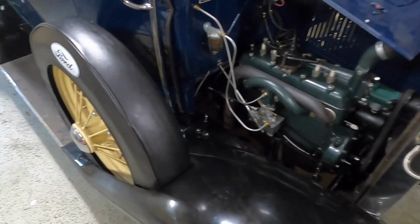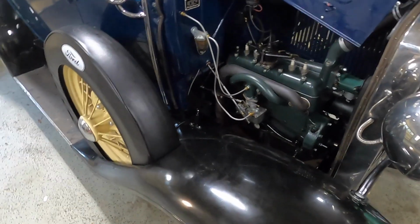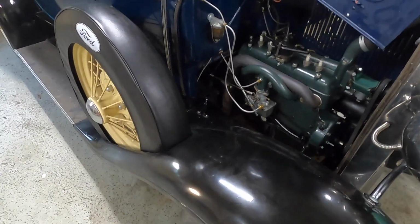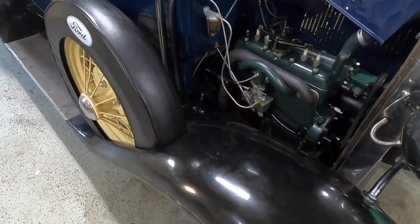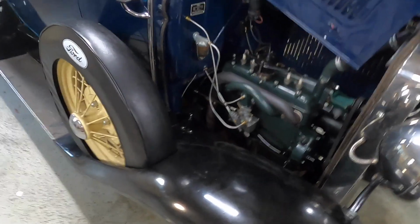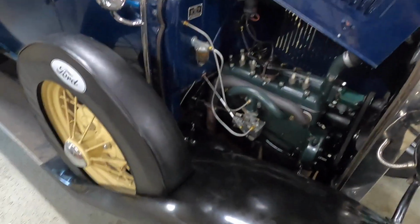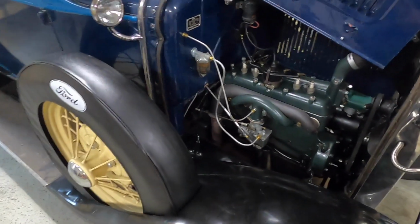And it has handled it all phenomenally. I have not had any kind of issues. The vibrations that I had previously with my old block, where the center babbitt had gone out more or less, they're all gone. Even when that engine was at its best, this one with the counterweighted crank in it is just smooth. It's still a Model A. You still get the same sound from it. You still have the same performance. You're not winning any drag races.